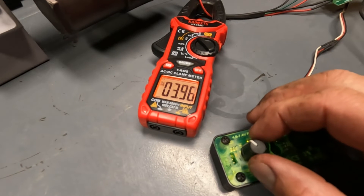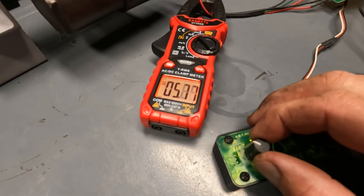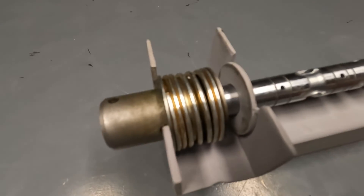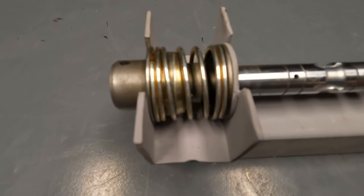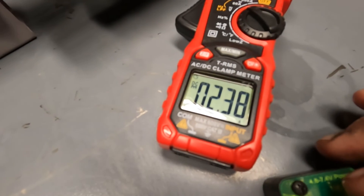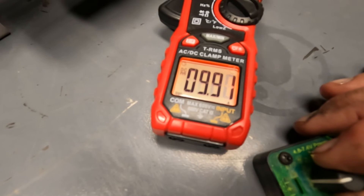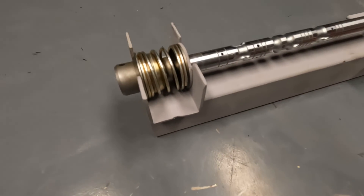Now I'm going to go beyond the end point — turn this a little more. The actuator is starting to dead-head; we're almost at four amps. Let's keep pushing harder — nine, ten amps. That's about nine to ten amps when we push all the way against the stop. Back to dead center and we're at zero amps. Move the actuator a little bit and we're holding at about two point three amps — anywhere between two and a half to two and three-quarter amps is fine. Now push it to dead-head again: nine, ten amps, and then it just starts to spike out — more current than my motor controller can actually handle. Then we bring it back down to neutral.